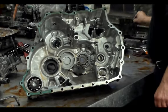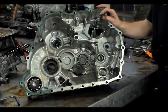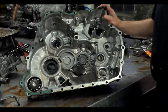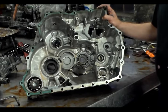So we're going to be looking for an issue, probably in a valve body. I'm probably going to find some kind of a valve dragging in the bore to cause this problem of really not shifting cold, but shifting when it was warm.